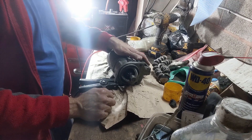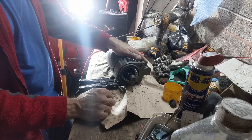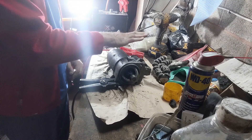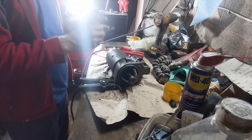There was no heat shield for this on the car, and the TL7 is meant to have a heat shield to protect the solenoid, so it's entirely possible this is burnt out. The next thing is to take this off, clean it up, and have another look at it.